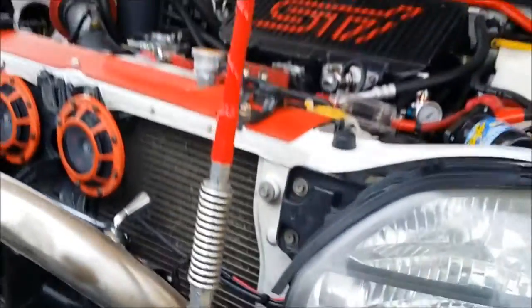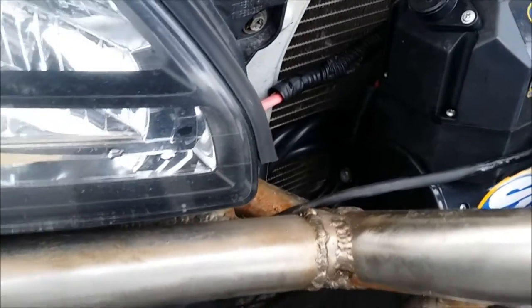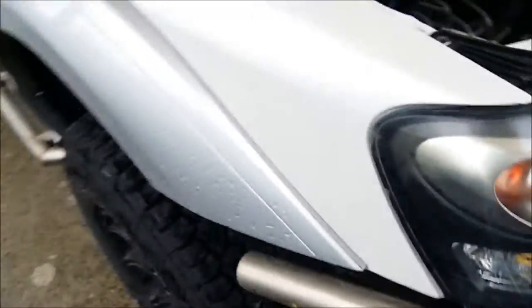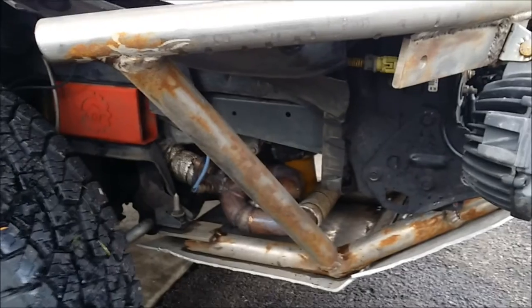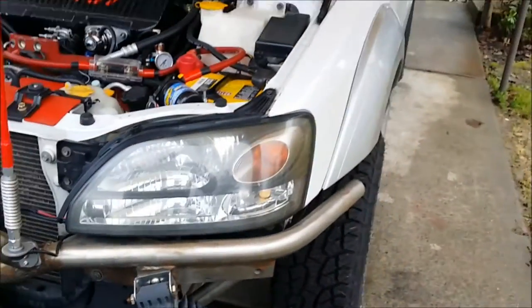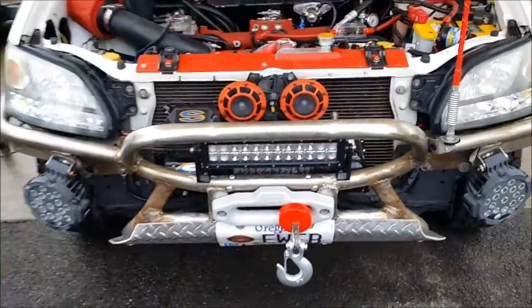This isn't pretty — I didn't try to make it pretty, I tried to make it rough because it's for off-road. It's all MIG, all wire-feed stainless — not TIG welded. I used about two or three passes on each weld, so I know it's strong. We've pulled this thing out of ditches with the winch and it doesn't budge. You basically just freestyle it as you go. It helps to have jack stands to hold pieces in place until you get them tacked. Once everything is tacked and looks decent, take your time and weld it all up. Everything I've done is something anybody can do — just take the time to teach yourself.